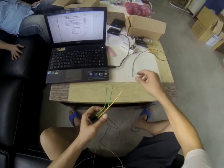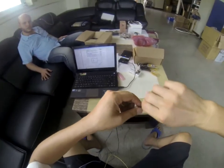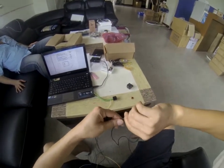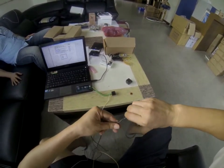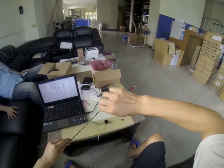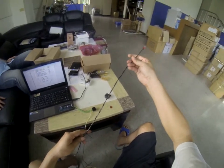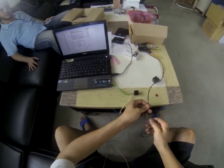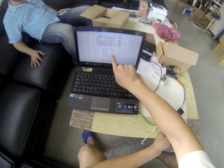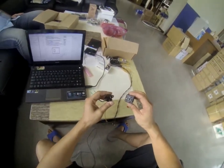Now, next, there are two wires to the fuse panel. Now it's not a fuse, it's a connector. And by the way, to make the life longer, we had better give them some protection. I will do that later. So now there are two wires. We need to use their normally closed connection, which is 30 and 87A. 30 and 87A.